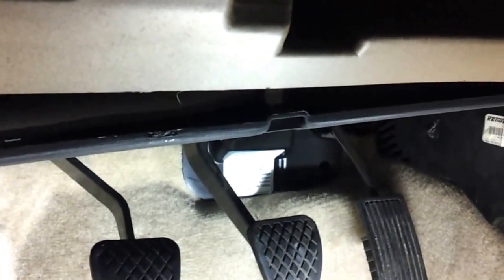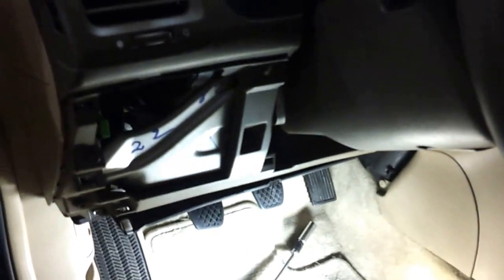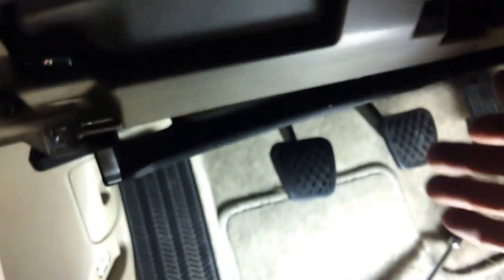To peek up at that, I had to take off the front lower piece of the dashboard here. That was a pain. Disconnected the sunroof switch, which plugs in right here. That allowed me to get to this shield down here — this cover — which has three snap pins, and then this pulls out.